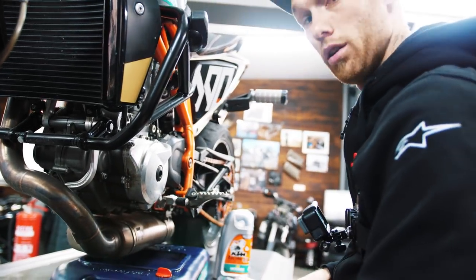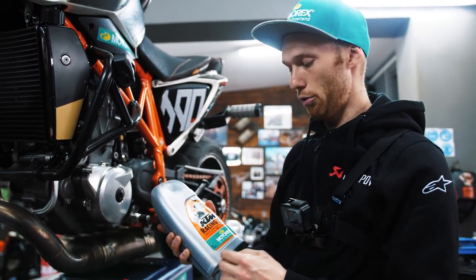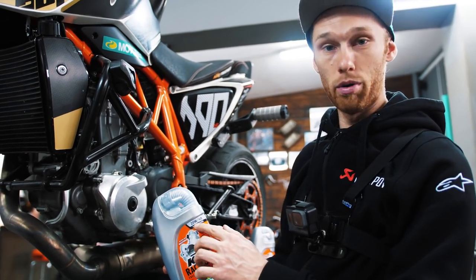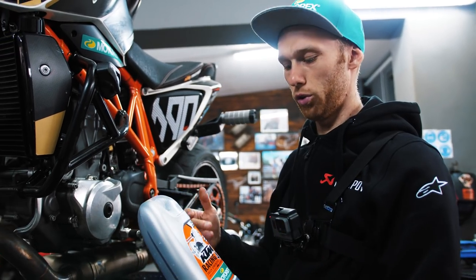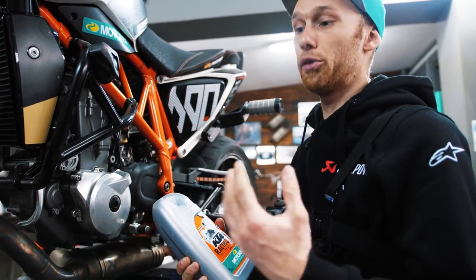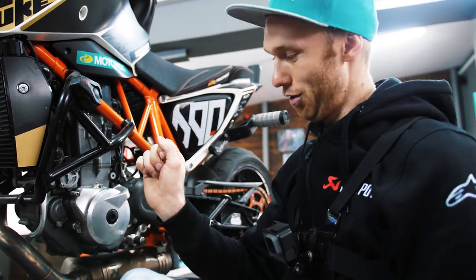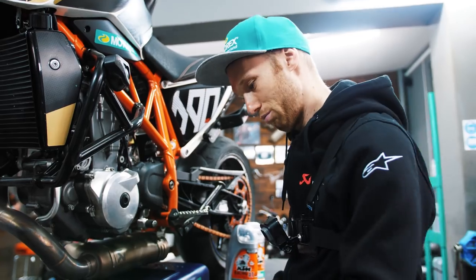So which oil are you using in your KTM? Usually in a regular bike we use a 10W-60 Motorex full synthetic oil, but since my stunt bikes reach really high temperatures, we use the thicker oil — 20W-60. For those who don't know what those numbers mean: it's the viscosity, or the thickness of the oil at low and high temperatures. A thinner oil doesn't withstand high temperatures, and too thick an oil means circulation isn't good enough and it won't reach the camshafts. You need to be specific about the oil, especially when you have a heavy wrist. I'm going to change the oil now and we have all the filters here — it's a quick, easy job.